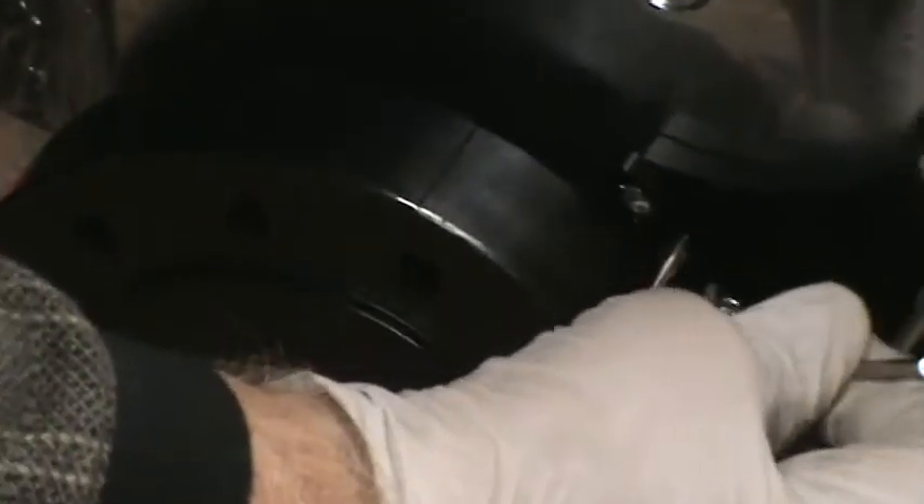This balancer is a little bit confusing, I would say, because it has marks at zero, ten, twenty. The line at zero goes all the way across the balancer, but the issue is the number zero is printed right next to the two-degree mark — actually no, that's four degrees; these are two apart. So the number is printed at the four-degree mark, and ten, twenty, thirty etc. are all printed exactly on ten, twenty, thirty. Just make sure you understand the pointer numbers so you'll be able to do this successfully.